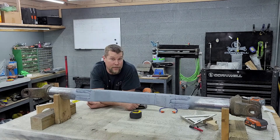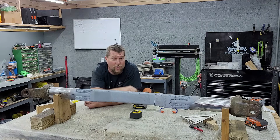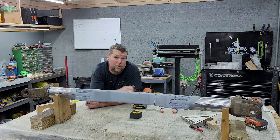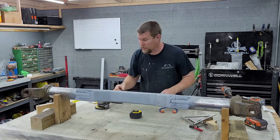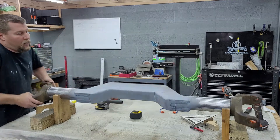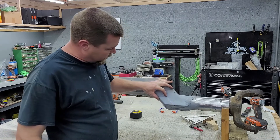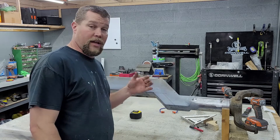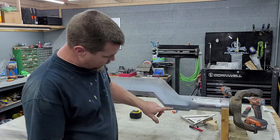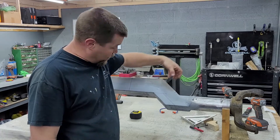Back on the table now. I took a bunch of pictures and looked at everything under there real good, and believe it or not the entire motor is set toward the passenger side in this truck. I have no idea why, but I'm sure Ford has their reasons. What I did is I took some measurements while I was under there and laid out what I think will clear. Essentially what I'm gonna do is cut out this section, stick it back over there, put it underneath and let it back down to see if I have enough clearance. I should be able to cut a notch in it, flip it over and put it right here, and that should fit in there just right.